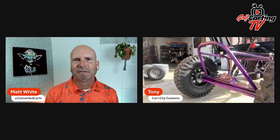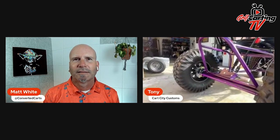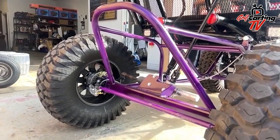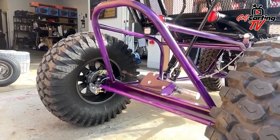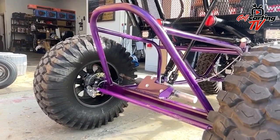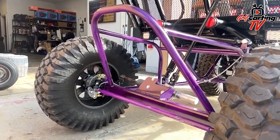And so what you did there is you've got a 4-bolt spacer, and then that's got to go through the adapter, which is a 5-bolt setup. Is that the main difference with the ATV wheels? They still are 4-bolt. Their spacing is significantly more, and the threads, the lugs themselves, are a little bit thinner. I forget what the measurement is, but if it's 4x1 or whatever, it's just a little bit bigger than that.